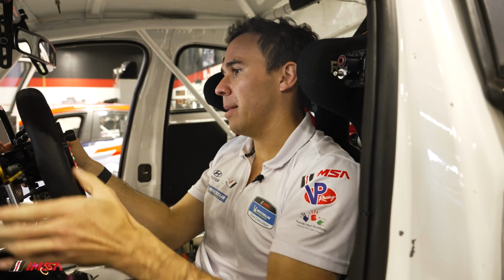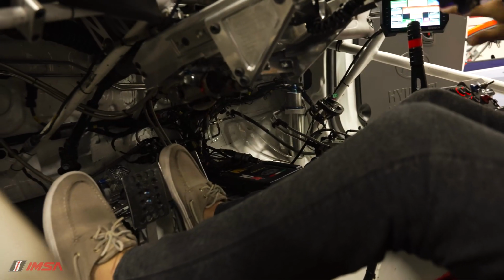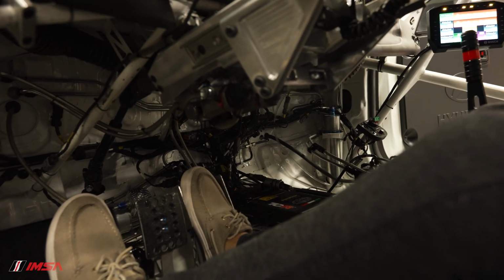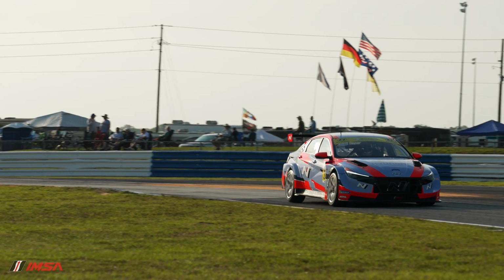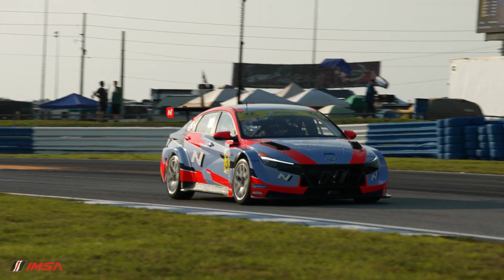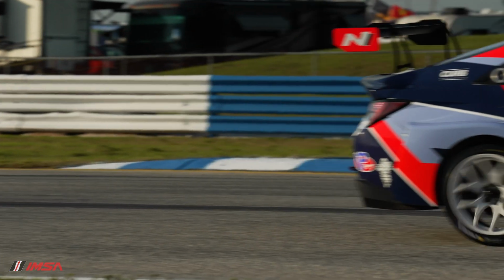So now it's a simple pull of the brake. It pushes these master cylinders down, and then the EBS does its magic and produces brake pressure to the calipers, and I slow down the car. With the Bosch Electronic Braking System, the EBS does indeed manage throttle, brake, also shifting as well, all on that steering wheel. A lot of stuff that can be done here. It's also, amazingly, transportable.